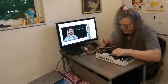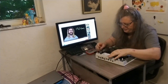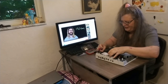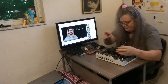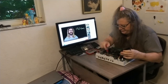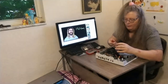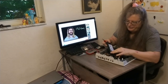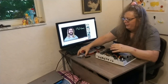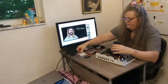Okay, and so we'll want to pull this out. There's some little plastic pins down here, so you have to really pull this out. This whole thing just sits in there, these pins sit down on the main board. Things get kind of clamped down, but I'm gonna want to remove this so that I can then unclip this, and we'll replace this bad damaged mechanical drive with our new solid state drive when we do that.